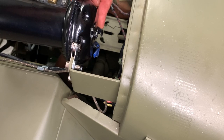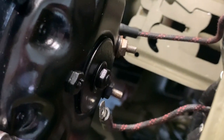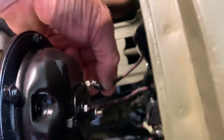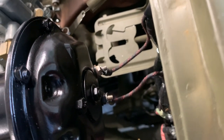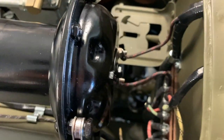Now we've got everything hooked up. I'm going to remove the tape I put on the contact studs before I painted the horn — I did paint this horn to match the black on the crossover tubes and the horn on the engine. The short wire, part number A5081, is red with a black tracer and is connected to the junction block on the post closest to the passenger side — we installed that in a previous video. I'll put that on the bottom stud of the horn so I don't cross the two wires. This is part of the same circuit, allowing positive power to flow through the horn. The other wire comes from the main wiring harness installed in a previous video; I'll connect it to the opposite stud, keeping the wires separated. Then I'll install the internal-external star washer and nut on the back side and tighten everything down.